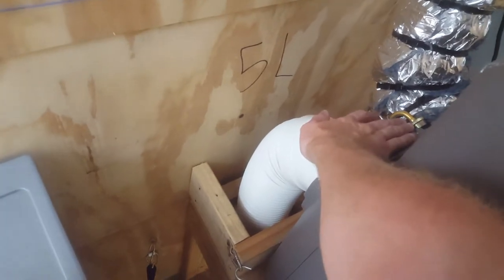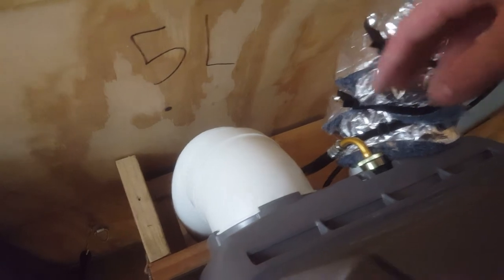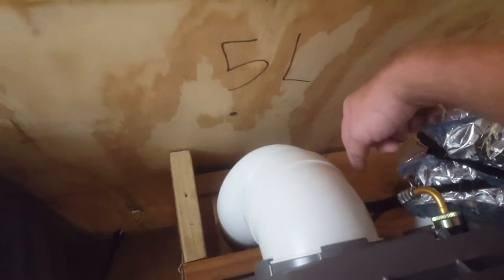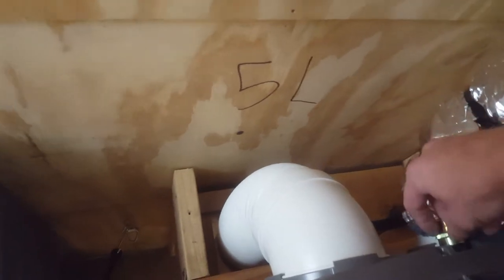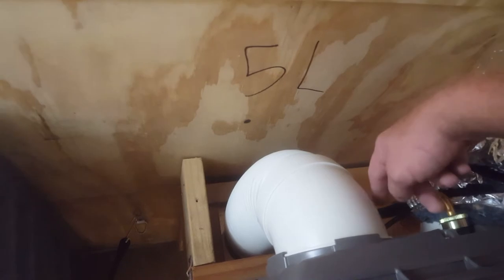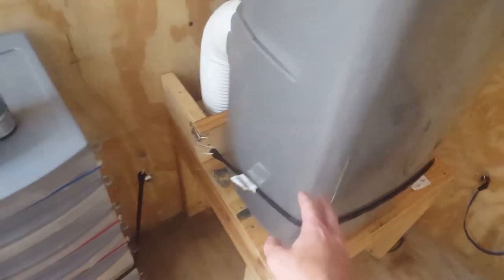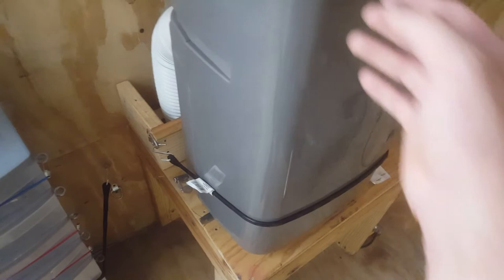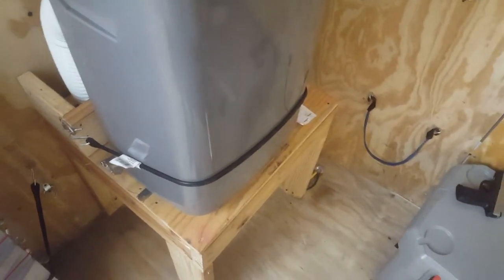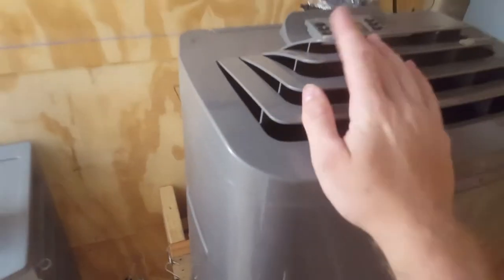This constantly drains out of this drain here, so I'll never have to drain it myself. There's another drain lower down — if you use that one, you can just put the plug they give you in this top one and use that lower drain. It'll save the water, hold it in a reservoir in the bottom of the air conditioner, but when the reservoir gets full the air conditioner will shut off and you'll have to take it out and manually empty it. It's a way better setup to just use the continuous drain like I did.